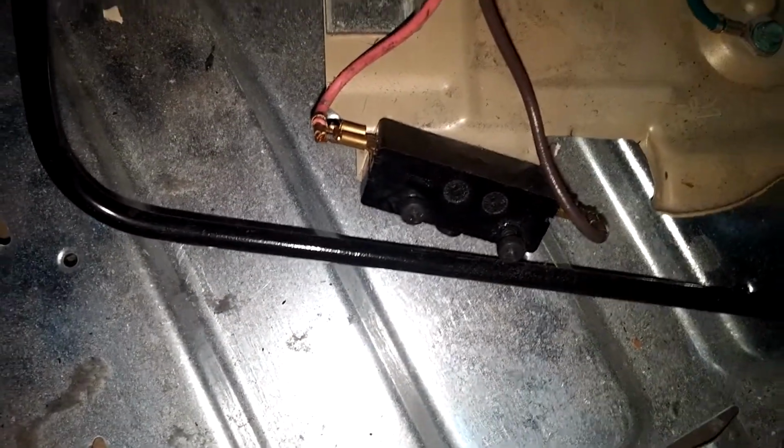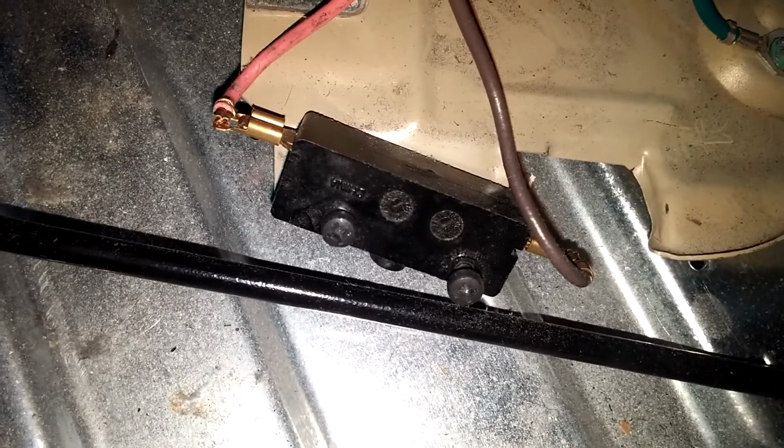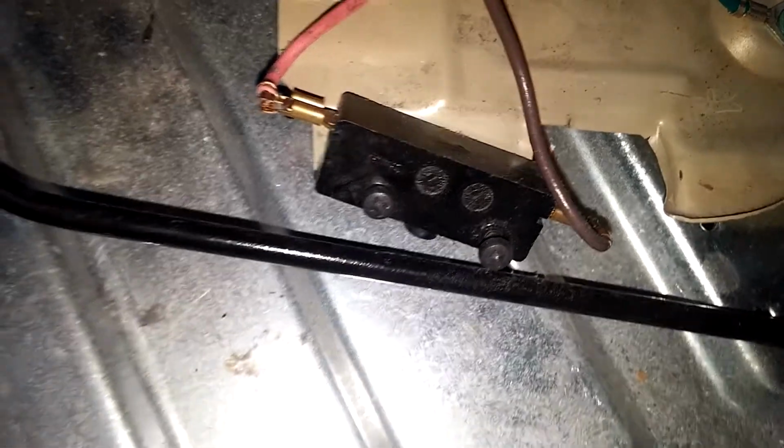This is a picture of the broken belt switch with the belt tensioner in front of it. I found it's a lot easier to install the frame and then install the tensioner with the shaft. You have to be a little forceful to get around that. See that curved up tan color curve to the right of the belt switch? That sort of holds it in place against the frame of the dryer.